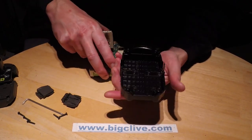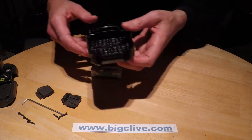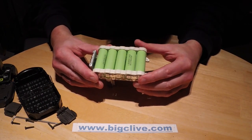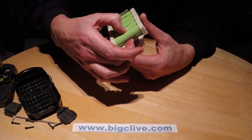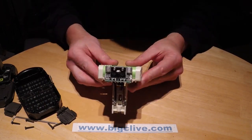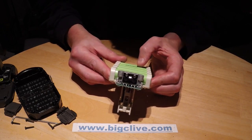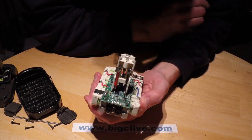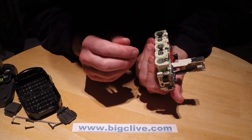The spring catches are plastic riveted — staked in. So what have we got here? We have a cluster of five 18650 style cells. In the numbering system, 18650 means 18mm in diameter and 65mm long. These are LGDAHA11865 — that's a very standard 1300mAh cell rated more for high discharge currents. And if you look at the size of the connections, it certainly looks like it's going to pass a lot of current.